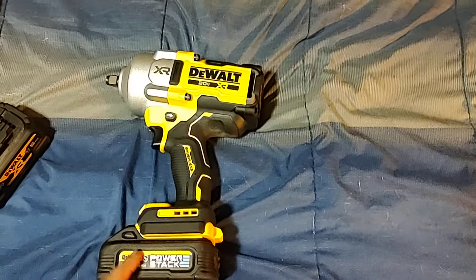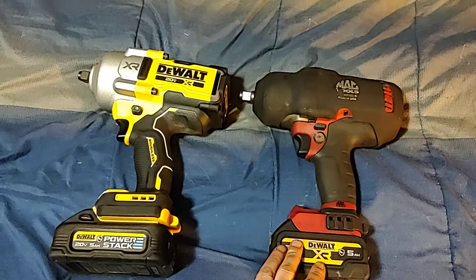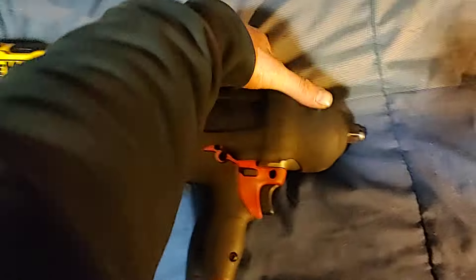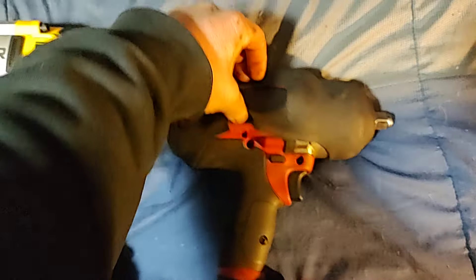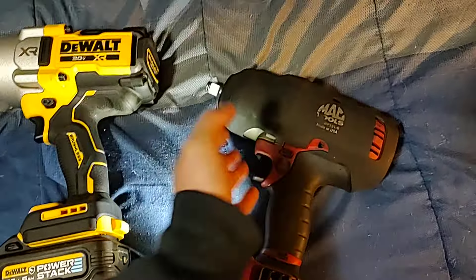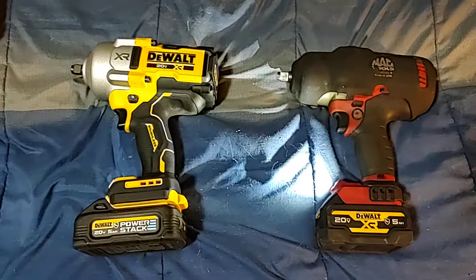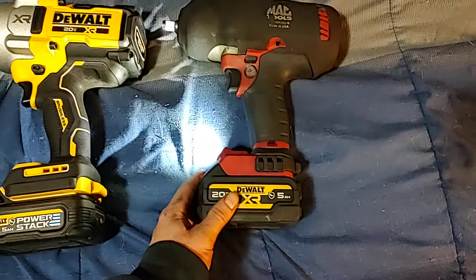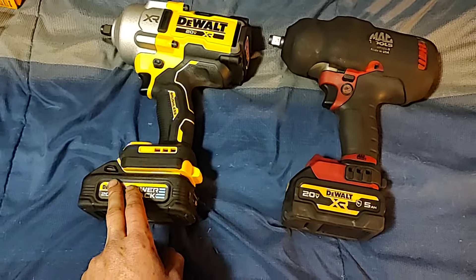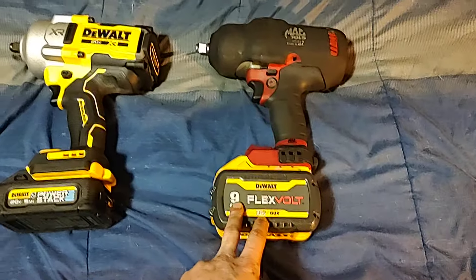If it's seized, this will just break it loose if it can. This is the BWP-152 — made in USA — still has the tag on it, pretty oily, with a Mac boot. I cover the serial number area with electrical tape just to keep it from getting dinged up. This gun has been good — no complaints. It does most of the truck lug nuts honestly. But it's a half-inch anvil, so I'm going to put a three-quarter anvil on this guy — I'm done waiting for them to bring that one out. If I need a little bit more power, I'd run the PowerStack on it.